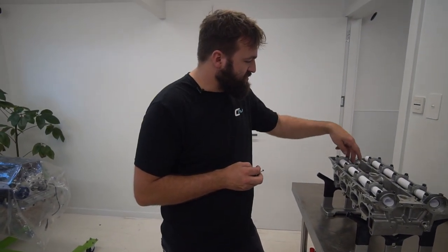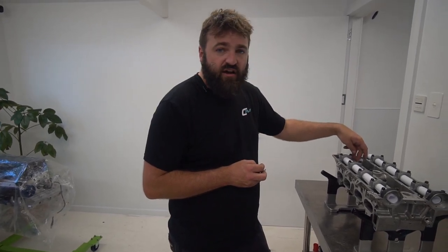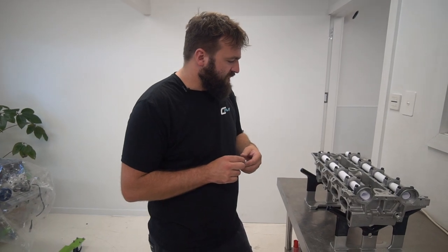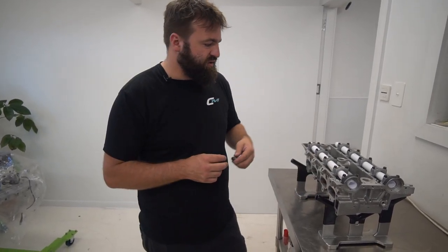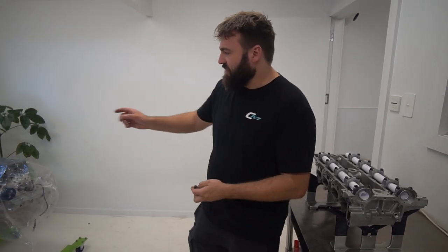I do have to pull out two exhaust valves, two intake valves, I think. And I have to tip the valves down a little bit more, about 2 thou on each valve. So you'll get to see that process. And just because I couldn't get the buckets to put those in a range that suited me. So tip those few down, put the other buckets in, re-clearance the head, make sure that's all correct. And then we'll go through and smack it on the bottom end.